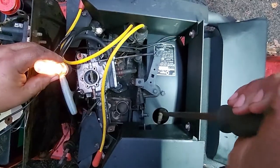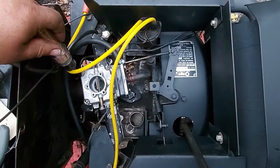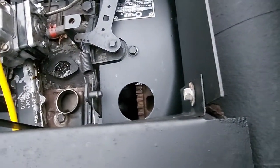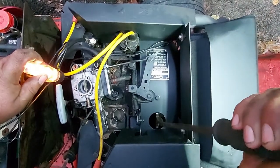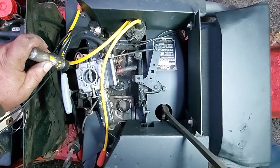When the line on the flywheel lines up with the gear case line, this light goes off because you marked it at 21 degrees. You can see those two lines lined up down in there — there's a little white dab of paint on the gear case cover on the left and the line on the flywheel. Closing is less advanced in your timing. If you open it up, you're timing sooner — it advances. If you close it, it retards it. So right there the lines are marked up perfect — you're at about 21, 22 degrees.